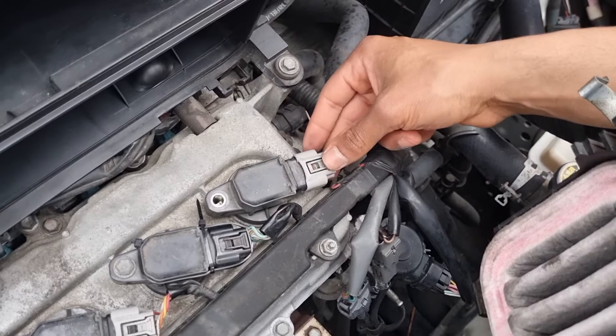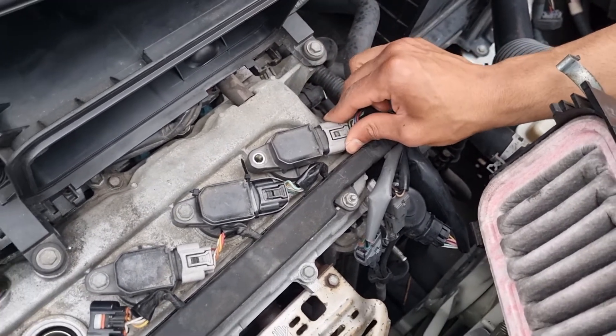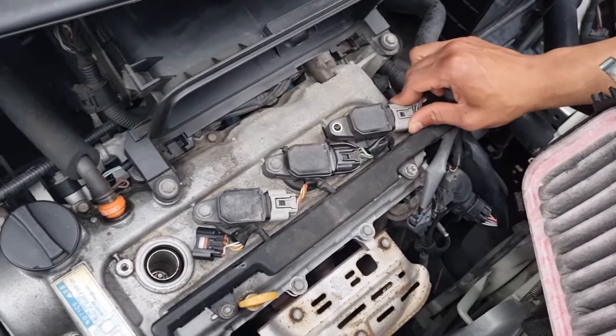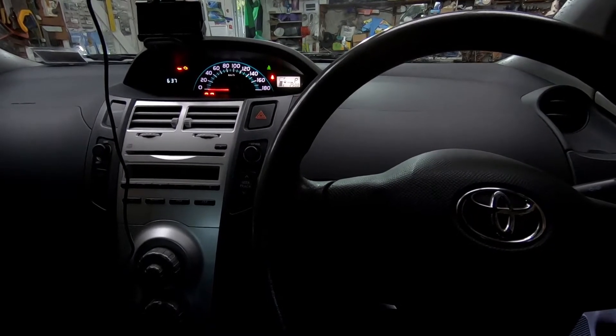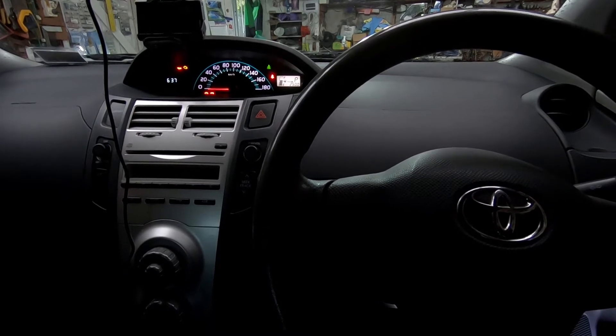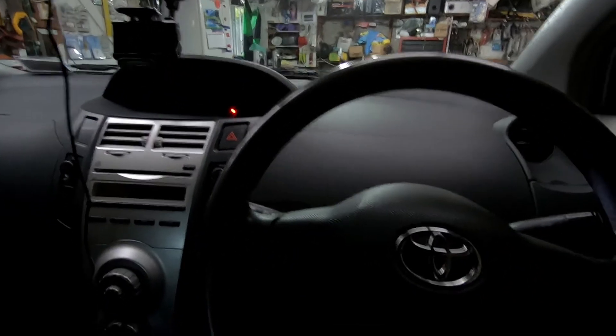If it's still not coming out you can use a bit of WD-40 around here. It's plastic so even if you break it, it's inevitable with heat and age — it does get worn out. That's how you do the isolation test: by isolating and removing the coil and moving it from one place to another.